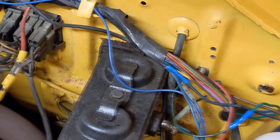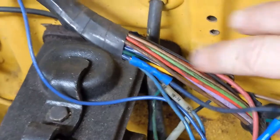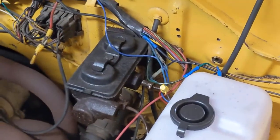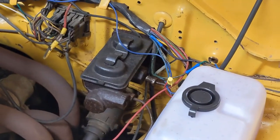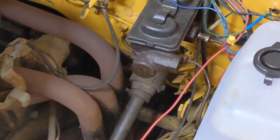Now that I've got the rod from the pedal off, I have to pull out these four bolts — there's two on this side and two back in here. Take those out and that master cylinder will come right out. That'll give us a little more space to move down on the proportioning valve, which is why I'm taking it out first, though the proportioning valve might have to come out from underneath.